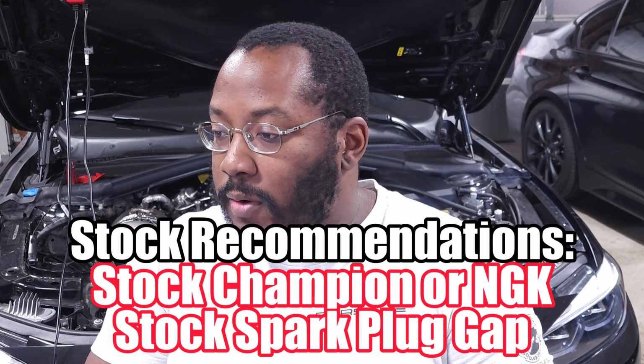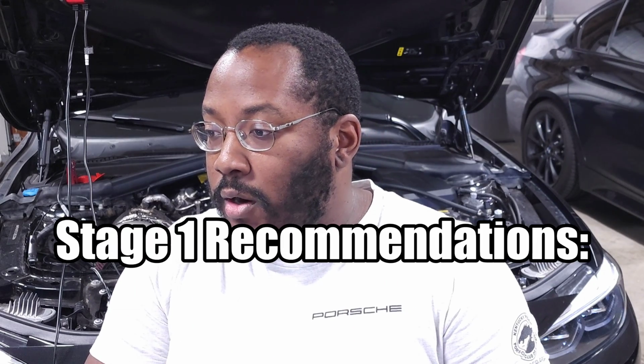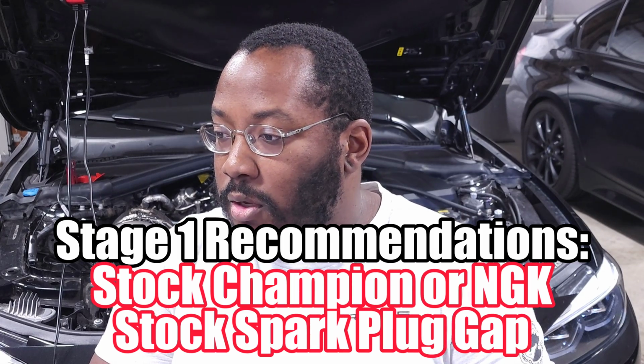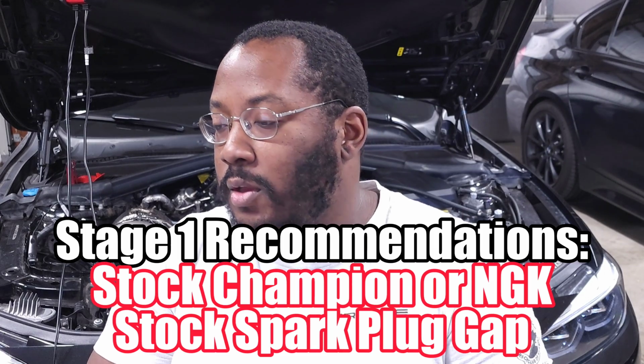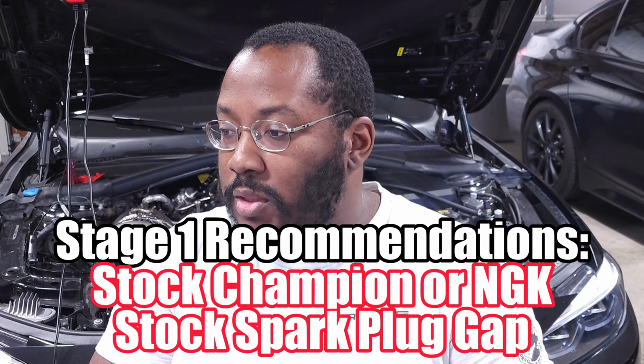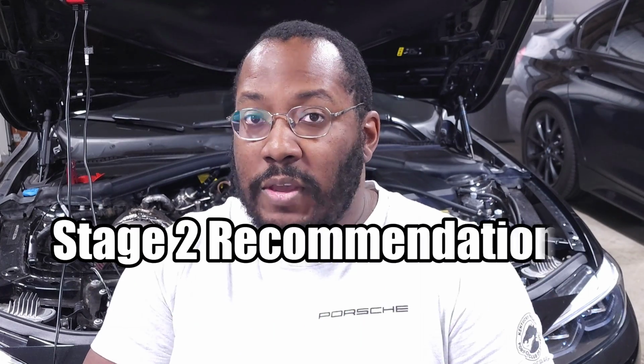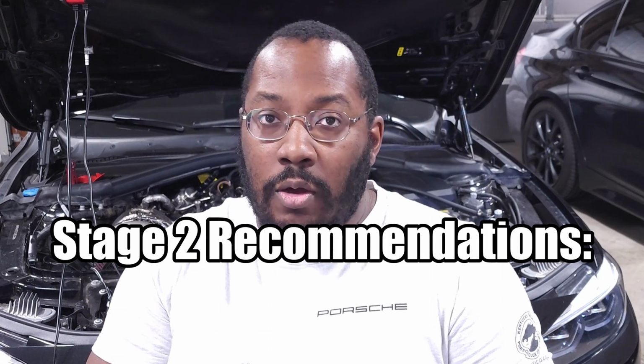The next setup I recommend for a stage 1 car are the stock plugs. So you should go with NGK 94201 or Champion 9425. And in the case of a TU, you go with the NGK 96206. Now, if you're stage 2, so if you have a downpipe, I recommend the OEM spark plugs.